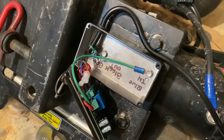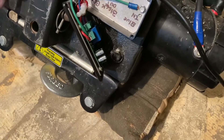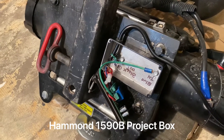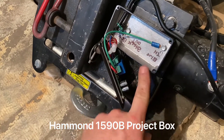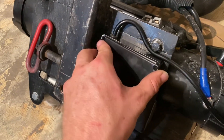I already slid it in once and it fits perfect, but I wanted to make sure you guys knew what you're looking for if you want to do this. Here is the part number for the 433 MHz Wireless Switch and remote control. Mine actually came with two remote controls — here's the spare that I'm probably going to hide somewhere in my Jeep. The black project case I used I got from a guitar pedal website. Since I dabble in guitar pedals too, I knew I could potentially fit this relay inside of a 1590B case, and that's what this is. If you use the part number I just gave you on Amazon you should be able to find it, or I'll put a link in the description.